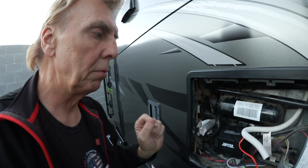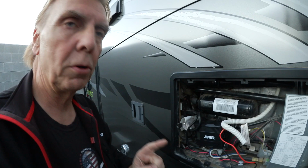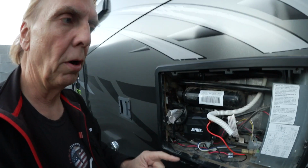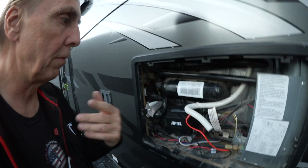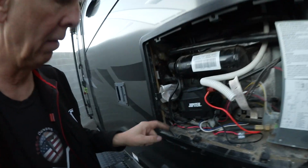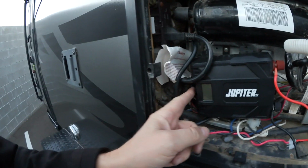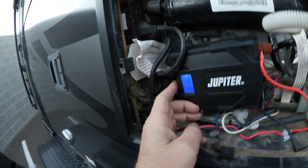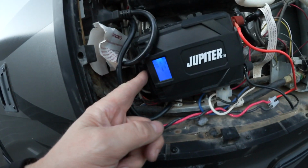And what's in here is the refrigerator, which actually works with gas, and it works with electricity when it's on 120 volt. Now the gas one, what we noticed when we were driving, the gas one was going off. And it was not working correctly. Maybe the flame was blowing off or something, and then we had the stuff in the refrigerator going bad. So what I did instead, here is the wire you see coming back. This goes into an inverter,